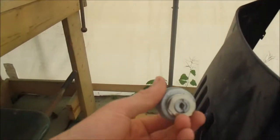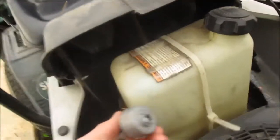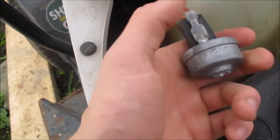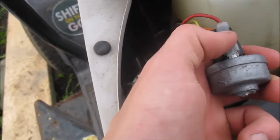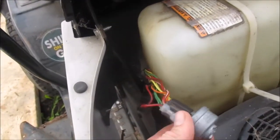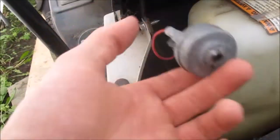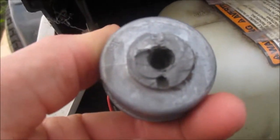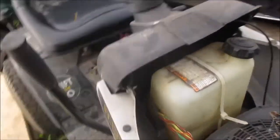I want to go put this switch in it, but this is only a 5-pin switch. The switch on this machine is a 5-pin switch but it's also got this extra little wire on it. I don't know if that's for a safety or a ground or something. I'm going to have to do a little bit of research on that, but I think it's just for a safety switch. I tried it yesterday and the previous owner tried to butcher the screw — you can see it's hogged right out in there, so there's no turning that. I put the battery in it and tried to turn it over. I wasn't even getting a click at the starter, so I'm starting to wonder if the solenoid's pooched or if the starter's locked up.